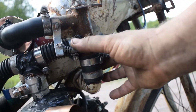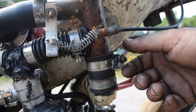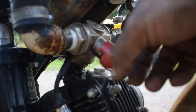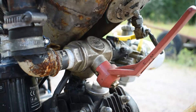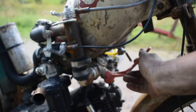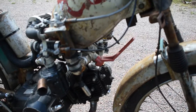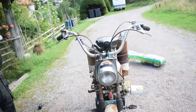Here is the mixer — I'm going to rebuild this, I am not happy with the function. I feel like it gets too little secondary air. And here is a two-way valve; the carb is on the other side. Here is the wood gas / charcoal gas inlet. I'm going to start it on ordinary gasoline and then shift it over to see if it will run today.